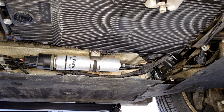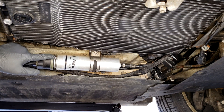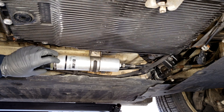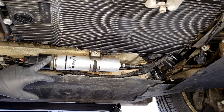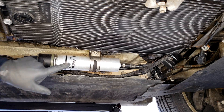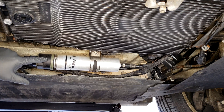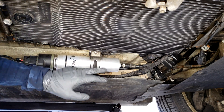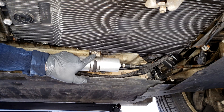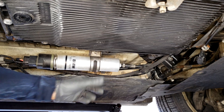There are two things you need to do: loosen the hose clamp right here, and pull this clip and pull. There's going to be a small rubber gasket inside that needs to be replaced with the new filter. Take note of the arrow. Also take note that this module has a poka-yoke — an aligning feature that will help you put it in only one direction. There's a 13 millimeter and a Torx to remove the piece altogether so you can slide it onto your new unit.